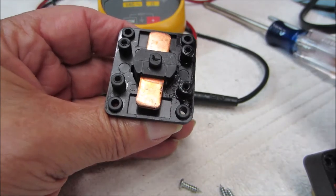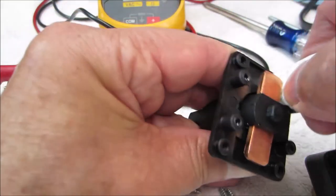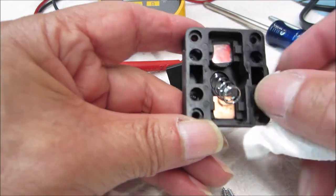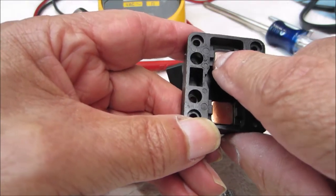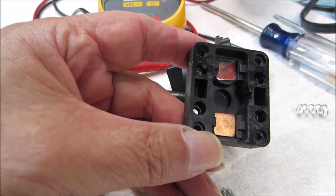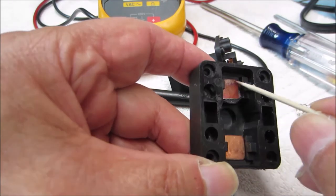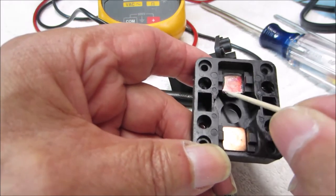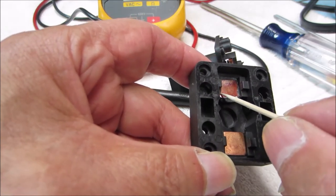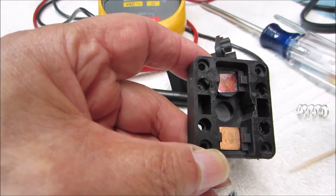So far I've noticed two things: it's wet — you can see some moisture in here, like it's been left out in the rain. That might have happened at the dump. But the other thing I notice — if you look at these two copper contacts, there's mold flash here on the top. There's plastic mold flash on this copper, and also some mold flash here. I'm wondering if the top contact is riding on that mold flash and not depressing. We're going to use a razor knife to cut this out, clean it up, put it back together, and see if we get some continuity.